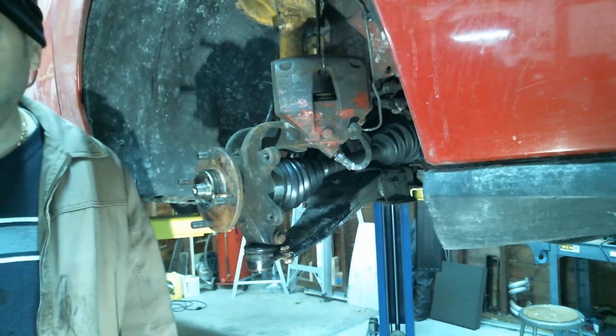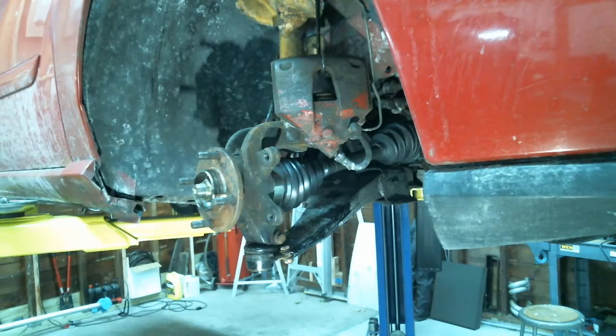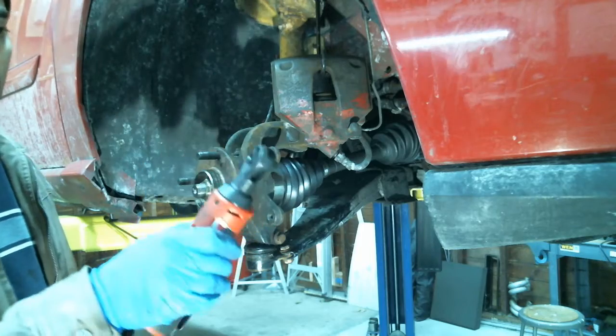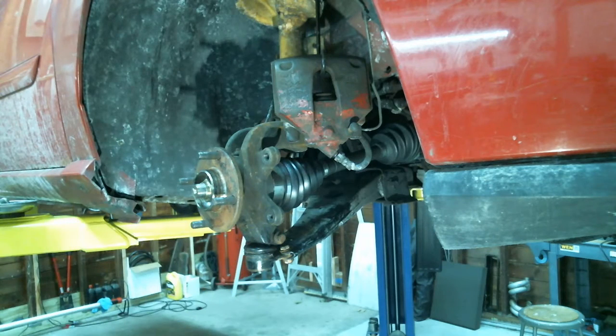Reverse was 1,000 reverse, something like that. Well, you can look it up. It's the Fuel, the brushless Milwaukee. Really, really good. What do we need? The ball jointed steering knuckle? Yeah. It's 37 foot-pounds. Okay. And this one is decent. This has a setting where you could just crack it loose and tighten it yourself and let the electric tool do the rest. That's pretty good.